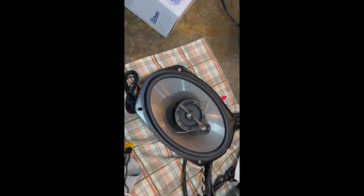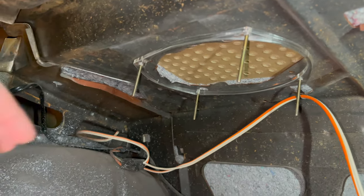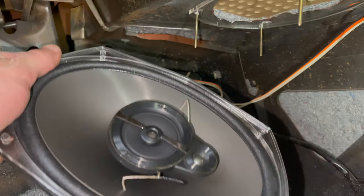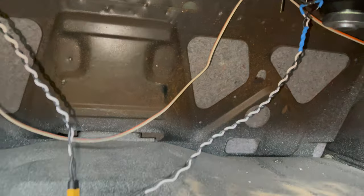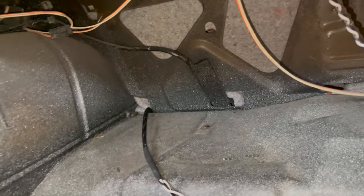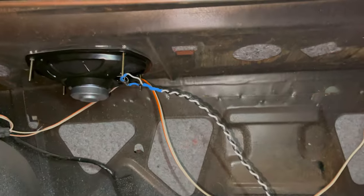In order to put them in place there are laser-cut acrylic spacers just to stand off the baffle a little bit. Here's the speaker mounting from underneath the rear deck — we got studs coming through from the speaker grille up top, then the acrylic spacers, and one in between the driver, and the driver just slides up right onto those threads. The speakers are hooked up with XT-60 connectors and a braided wiring harness running back underneath the rear seats.